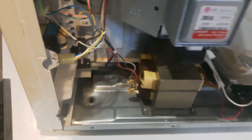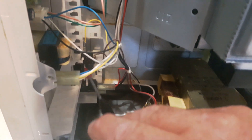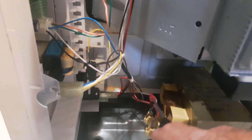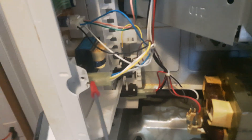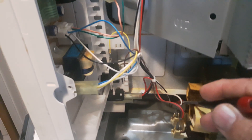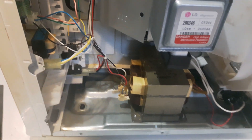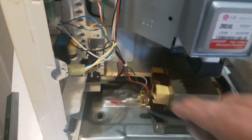So what we're going to do today is check for voltage. There are two connectors here. The red and the brown go to one switch here and to one switch here. The white goes through here to this relay. The white goes all the way down to the other side. The brown and red wires go to the two micro switches on the microwave oven door.